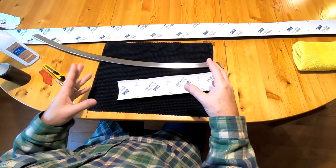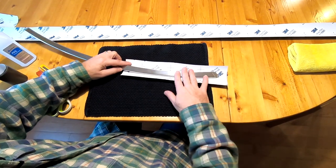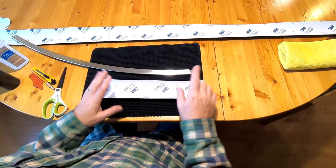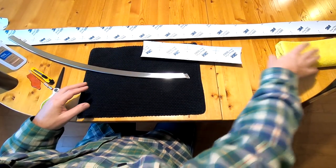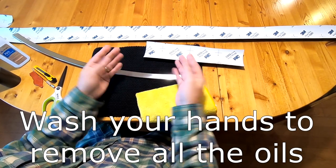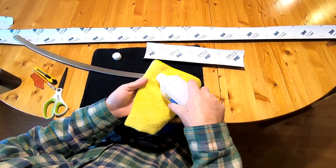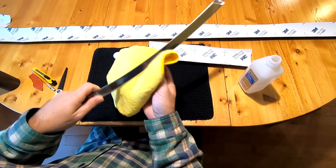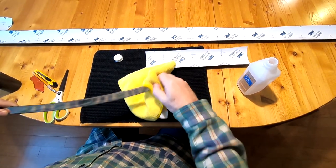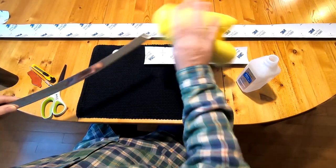Once you're working a whole long piece and worrying about all aspects at once, you'll be overwhelmed. So I took a one-foot sample piece and focused on figuring out the ends — that's the hardest part. Start all routines by washing your hands thoroughly with soap and water. Then wipe the bar down with isopropyl alcohol on a microfiber rag, getting into the ends where you'll tuck, and dry it off.